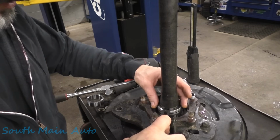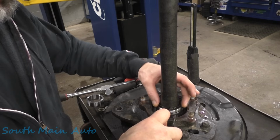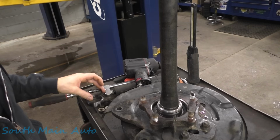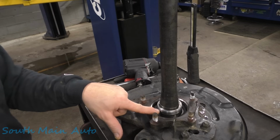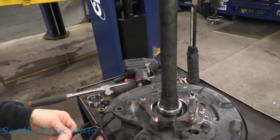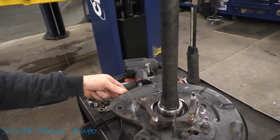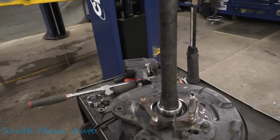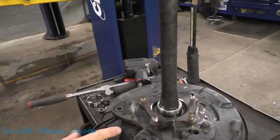We'll get our German made Knipex. Come on, baby. There we go. We'll get her up here. Up and out. We'll take that snap ring off. Okay. We'll save that. I can't remember if I can press these off with the sleeve or not. Typically. So that's how bad that bearing is, really bad. Typically, you'll slit them a little, kind of relieve the tension, if you will, which I think we might do.